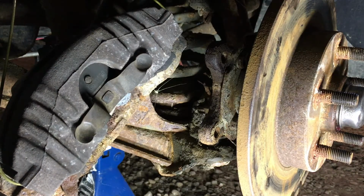So we've got those done, and now I'm going to put some on my... It seems counterintuitive, because these bolts you don't want coming off your brakes, but once again, where I'm from, they will become one with the car, and they'll strip their head off before they actually come out. So we'll put anti-seize on them, and then we'll just put them on tight. That'll get rid of the friction of the fastener.